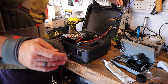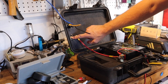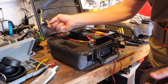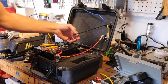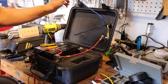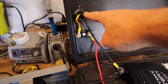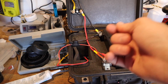With the positive connected to the cutoff switch, I'll disconnect the cutoff switch just to be safe and avoid any arcing. Off the positive end of the cutoff switch we run into our adapter — using the yellow lead as positive with 10-gauge ring connectors. The negative lead goes back to the battery. I'm trimming and capping the extra lead with heat shrink. We've also hooked up the leads for the battery charger, so it'll be easy to pop the case open, pull the leads out, and charge it up.